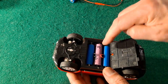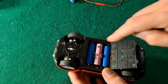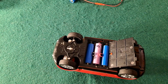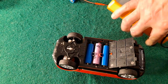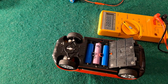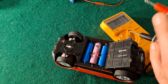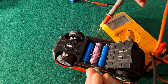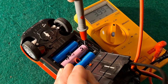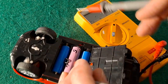So that's our 3.7 volts — if it's freshly charged it'd be a little bit more. These aren't freshly charged; they're straight from eBay, haven't been charged by me at all, so there's probably just storage voltage in it. Put it in the right way around — 3.99 volts, just short of 4 volts straight away.